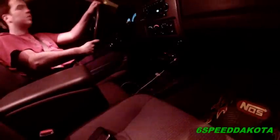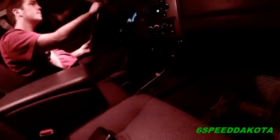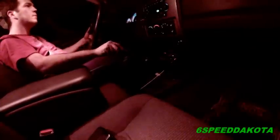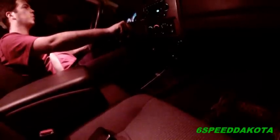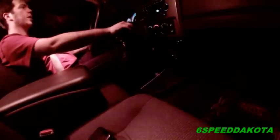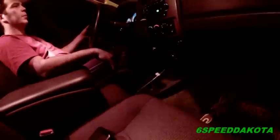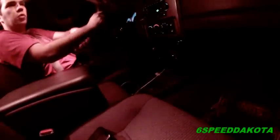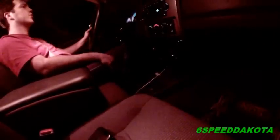Do a couple of nice easy stops, make sure that the brakes work before we take them out on the road. Perhaps I should turn my lights on. About 20, 25 around there somewhere. Make sure nobody's behind us and just make a nice easy stop with the clutch out. We just want to work the brakes a couple of times and make sure that we can get those pads seated up nicely and not let the camera go flying. Speed here, so we're doing about 35 or so miles an hour, about 50k.